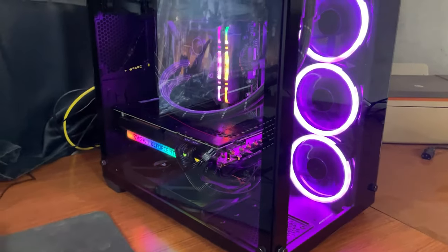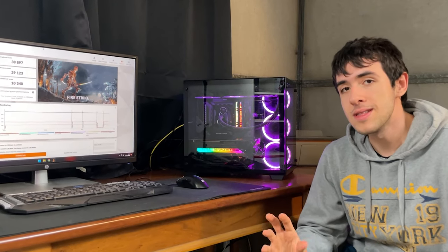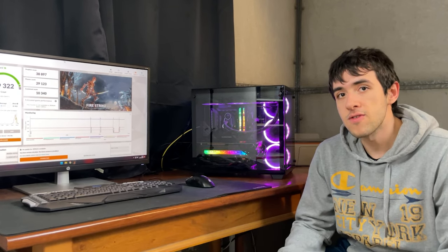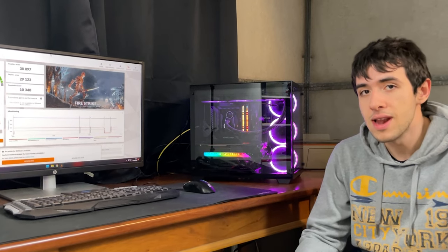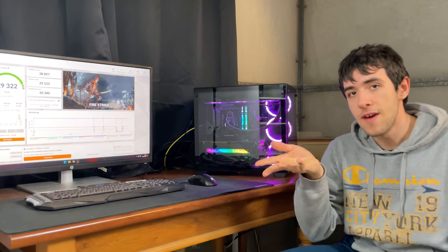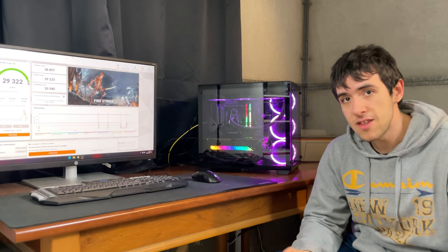The PC is fully finished after testing all the games. It really looks stunning — I love the new Mars Gaming case. It does pretty much everything the competitors do but at a cheaper price, and more importantly it's much more compact. It's insane they managed to pack two 360mm radiators into such a small case. Temperatures are really nice — there's great airflow. Two fans at the bottom push air up, the Arctic radiator fans on top pull it out, creating slight negative pressure which also helps with dust.